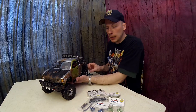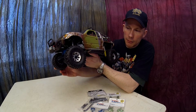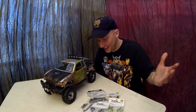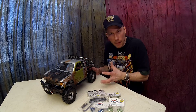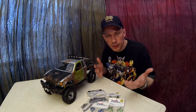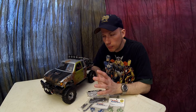You're probably noticing I don't have the steel RC4WD bead locks on there anymore. I still have them, but I decided to pull them off because I was having separation issues — the beads were actually popping out. It was an issue I was fighting for a while. Even up on stands with no pressure on them, they would just keep popping out, so I pulled them off.